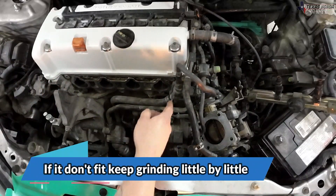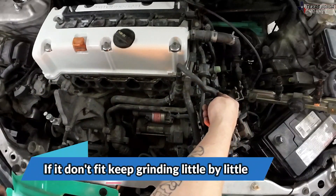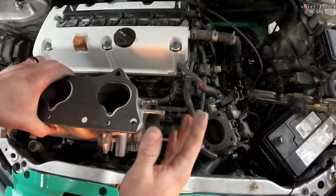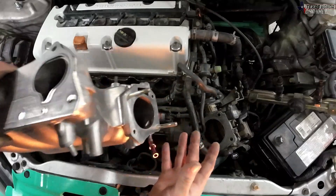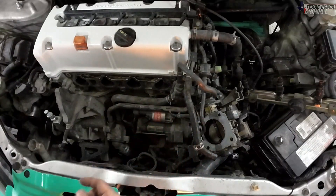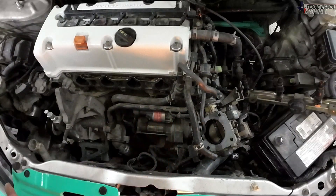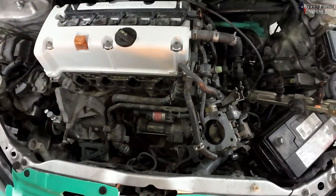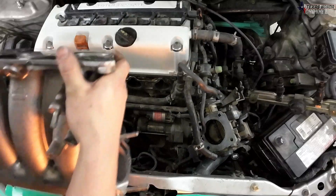This piece right here is where the upper radiator hose goes, so that's why we had to chop it off this manifold. If you're using a K24 it's not going to have this — the radiator upper hose goes back here. They do sell an adapter if you ever decide to cut one of these and use it on a K24; you will have to get an adapter. I'll link it in the description, but I don't have to since it's a K20A3 — K20A2s are the same way. I'm going to go ahead and slide this on.